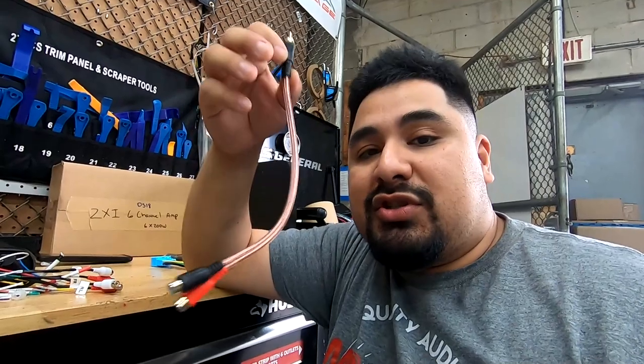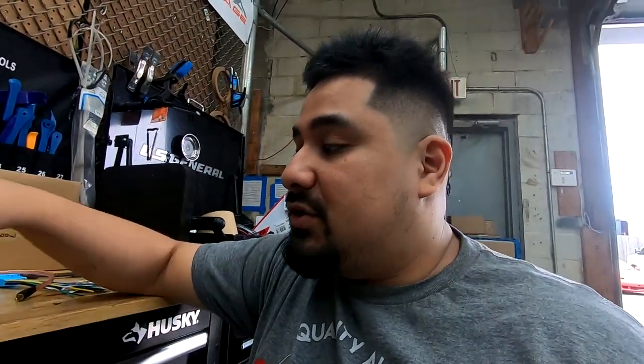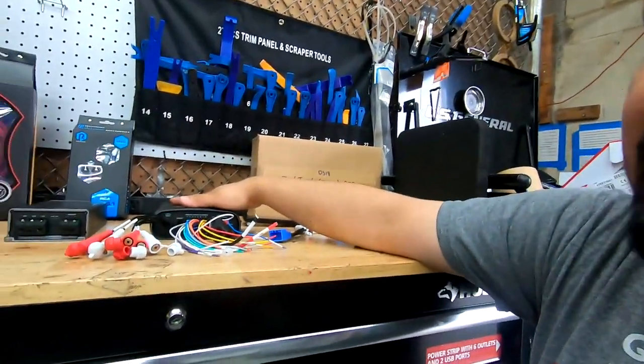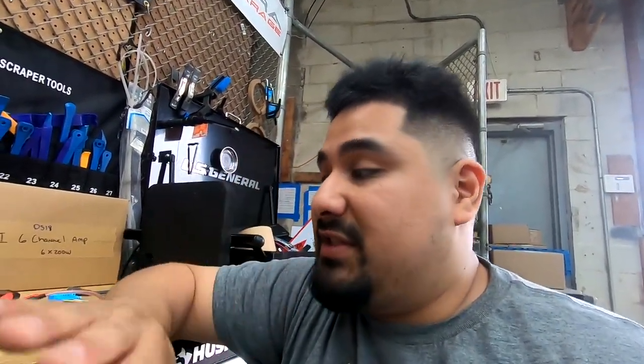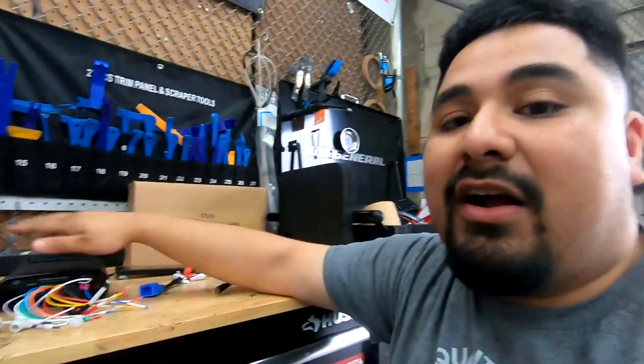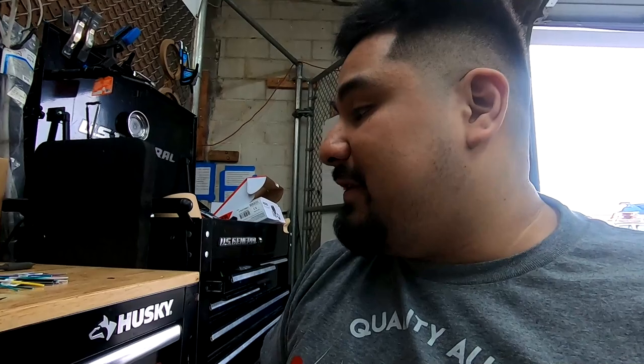It's not a problem, just know that this is what you will have to do if you don't find an amp that has that feature. If you have an aftermarket radio installed, you wanna make sure it has 6 RCA outputs so that you can use those outputs to drive the speaker amplifier and the subwoofer amplifier separately. So you're still only gonna send 4 channels of RCA to your main speaker amplifier and then 2 for your subwoofer. So you wanna make sure you pick up an amp that has that feature.